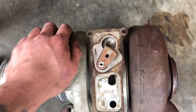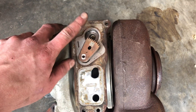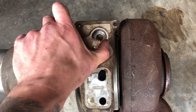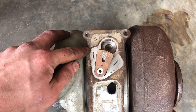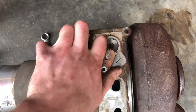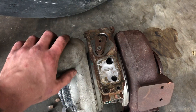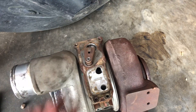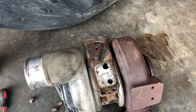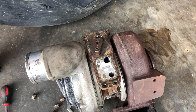In my case, I had an engine failure and a piece of metal went through the turbine, which damaged one of the VGT vanes. That mark right there is 100% — mine will only open to about 60% before the broken VGT vane contacts the turbine housing. I was able to catch that in time before it burned up my actuator, within probably 10 minutes of run time on the new build.